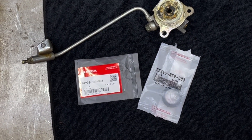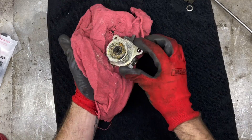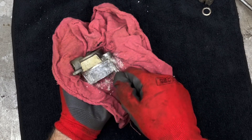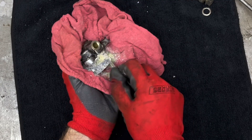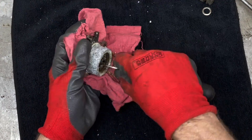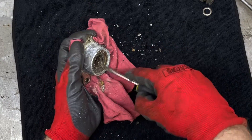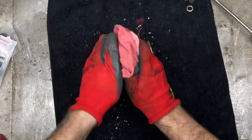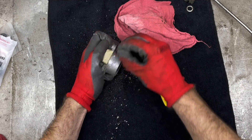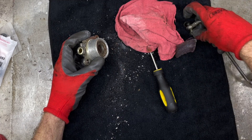Now to the slave cylinder. These are the two seals I'll be using to replace it — that center one as well as the cup seal. I'll put the part number in the description. If you wanted to, you could leave the slave cylinder locked in with the banjo bolts and bleeder and just pump it out with the clutch lever, but it's going to make a huge mess. In this case it was locked, so I couldn't do that. I spent time scrubbing and cleaning and verifying that the cylinder can still be reused — the outer portion is not as crucial as what the inside looks like.